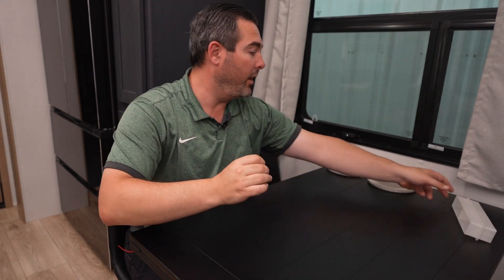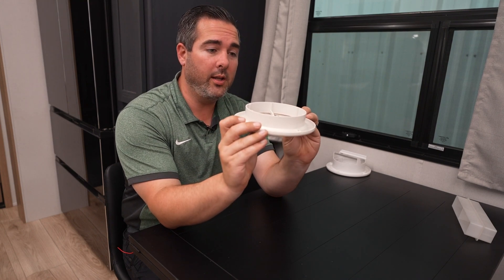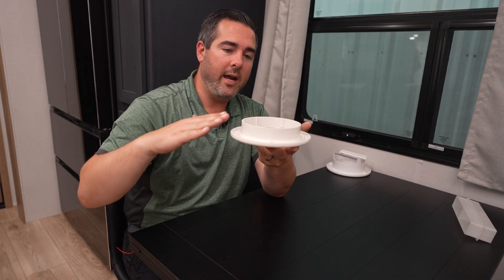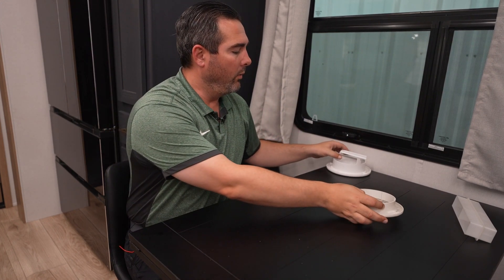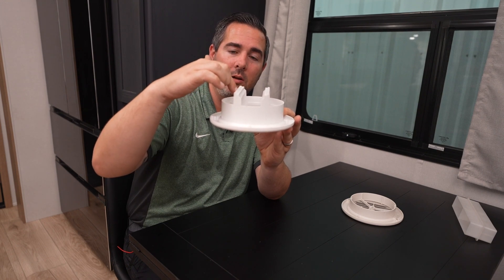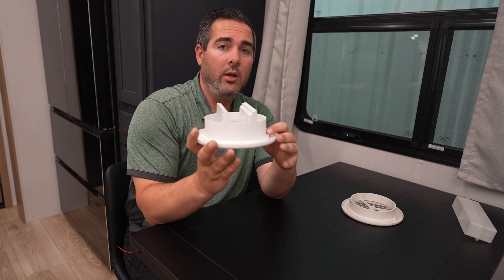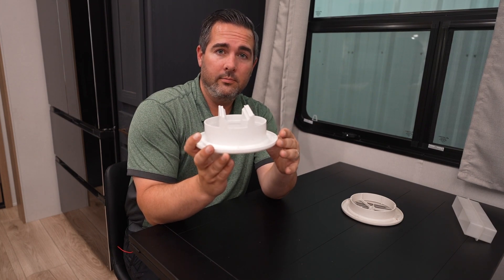What I think is one of the most important facets is the rotaire. This is your traditional rotaire that goes up into the ceiling, and as you can see, there's nothing here to actually make the air come down and inside the unit — it just kind of goes over and whatever comes down. What we did is put flanges on, so the air going over the top is now directed at an angle to go right down and inside your unit. This whole Trio Airflow System is all about creating efficiency and cooling down the AC unit faster.